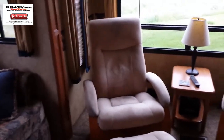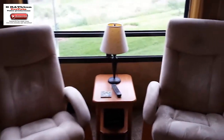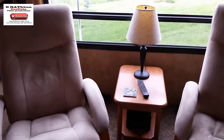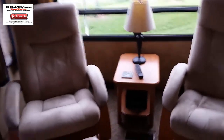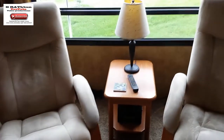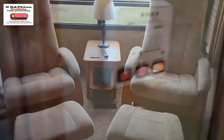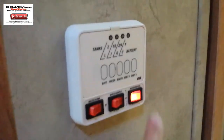In our case we have two chairs here with a slide-out on each side. If you push the slide-outs in they're going to smash the chairs, so they must be secured — we turn them sideways, tuck them in, and tie them down so they don't rock and roll. We set the lamp down as well. Secure the area so your slide-outs can travel in and out freely.